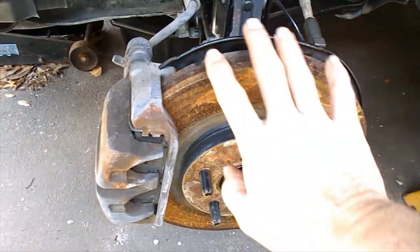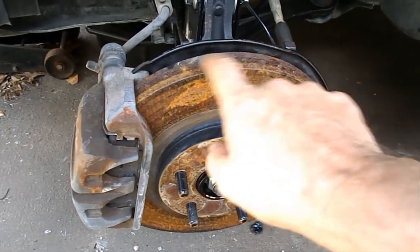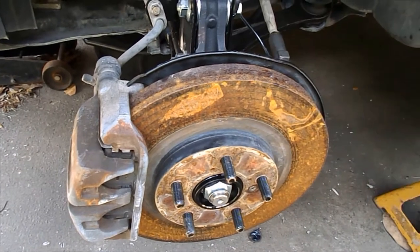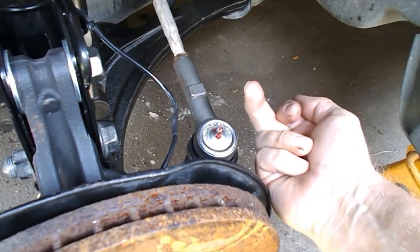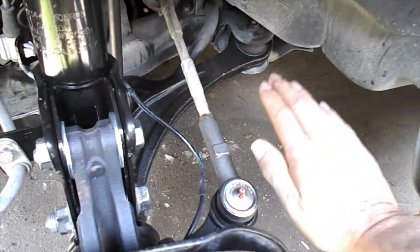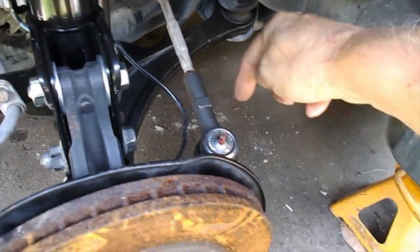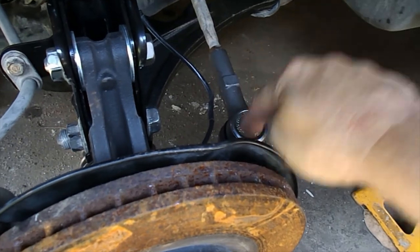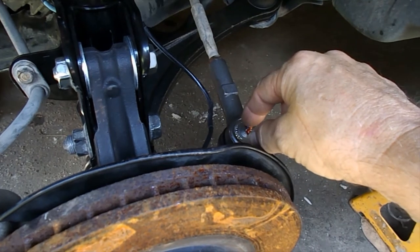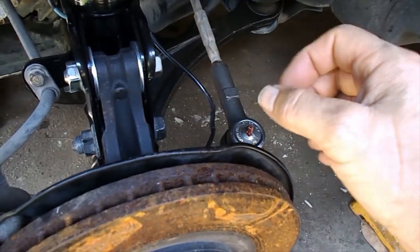Here we are at the Ridgeline — this is the driver's side. The brake assembly is going in separately. You can see now that the tie rod is on top of the knuckle instead of coming from underneath, which would have changed the angle drastically and probably caused bump steer or steering problems. I used a brand new tie rod and drilled the knuckle like shown in the previous video — there's a sleeve in there with a proper taper. Once nutted down from underneath it sucks the tie rod into the sleeve and makes it super tight.